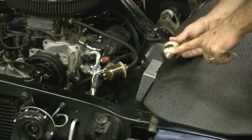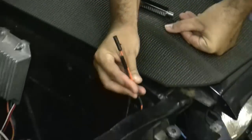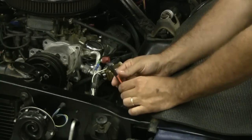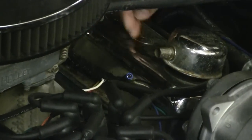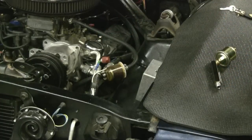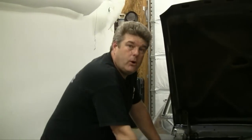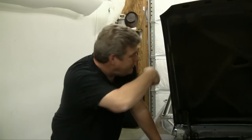With an actual oil pressure gauge in this car, you'll need to replace the oil sending unit — this angled one makes for a much easier connection. Under the hood we also have wires for an electric fan and fog lights. We're not ready for those yet, so we've put female connectors on them so they won't ground out, and we'll put rubber boots over them. There's also a connection for an electric choke that we do plan to use. Other unused wires are wrapped back into the harness and taped up out of sight.